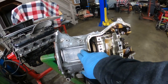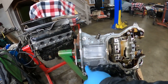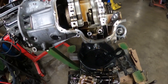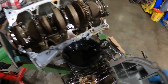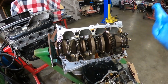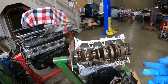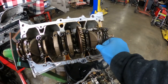I'm gonna remove the oil pan. I removed most of the bolts — there are two inside and a couple around the outside. There's also one under this oil feed adapter, so you have to remove the adapter to get to that bolt. I'll put that to the side and start removing the pistons — there are four of them. These engines have oil squirts inside the block, which is pretty nice — no wonder these engines last a little longer.